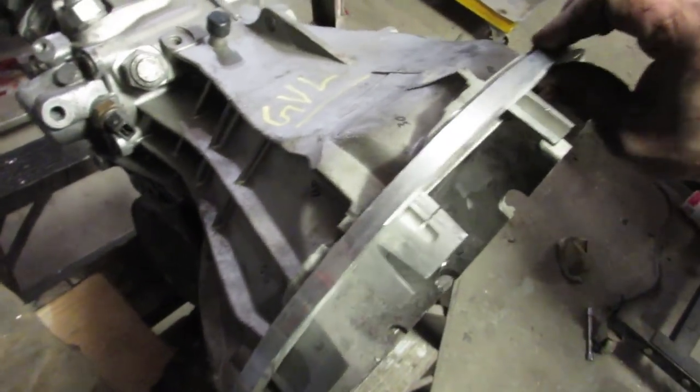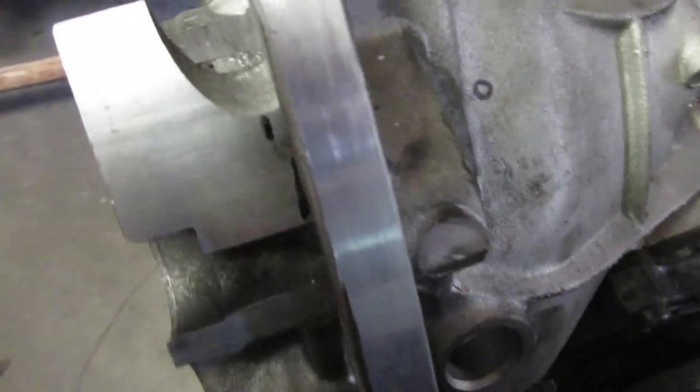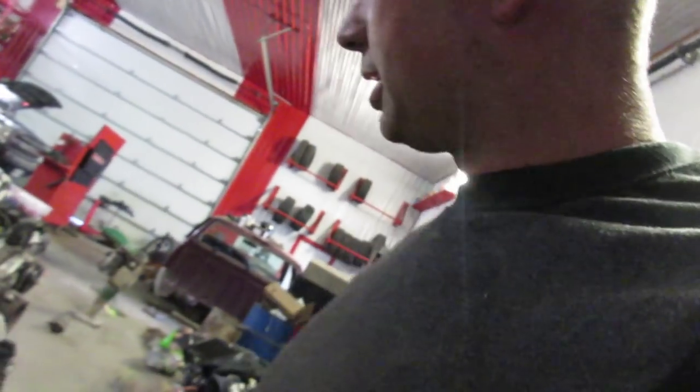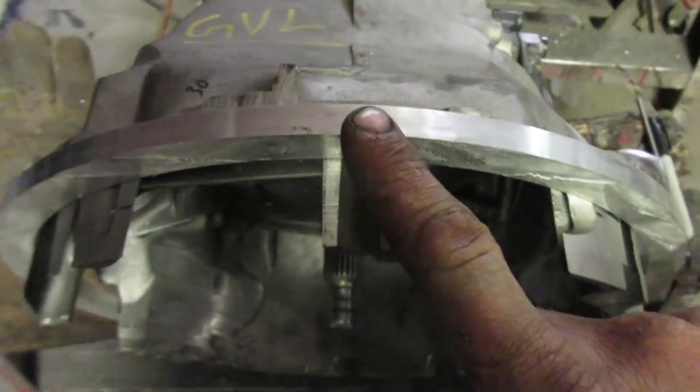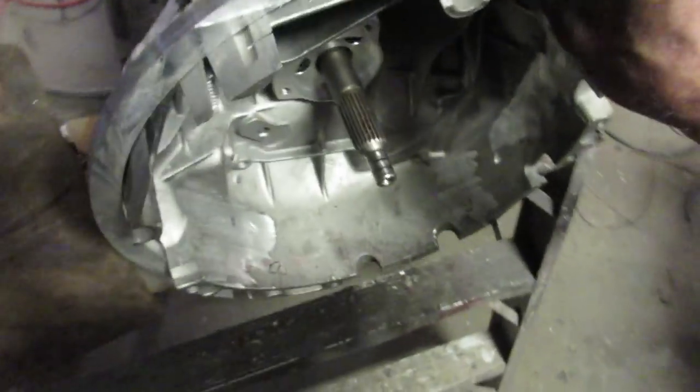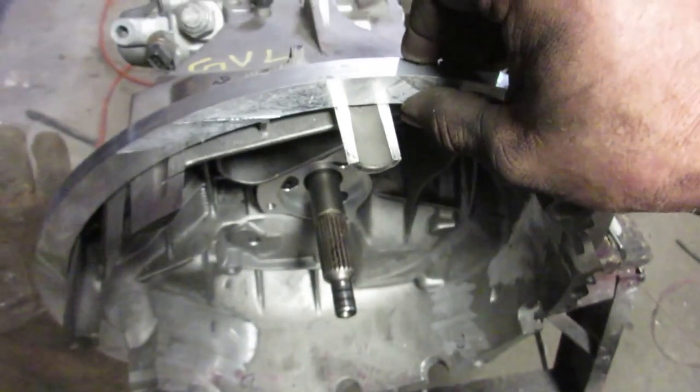Not that it matters, because I still have one machine surface, and we'll just put that side up against my router bit. So now I got my gap perfect. See that? You can just see the line, just like roofing. You want to see that chalk line, because otherwise you don't know where the line is. And this outside diameter fits perfect on the inside diameter of this. Problem is, my routering was off by about 60 thou. So it's able to do this.